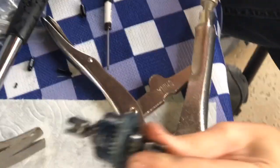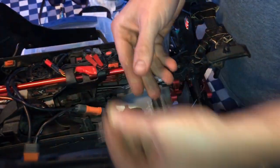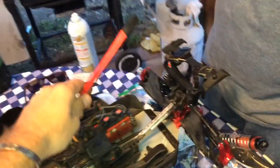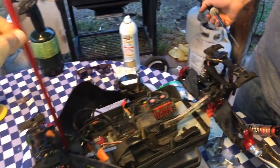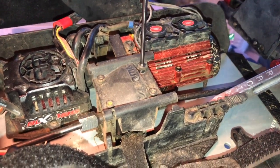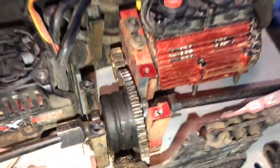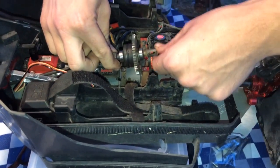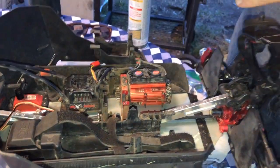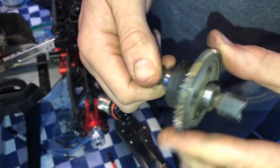Now I've got to take this apart and clean it. That part just pulls off with the little cotter pin — easy, two of them. Get that out of the way and then you've got to take this bar off. You just take that one out — one screw, bring it up. This thing looks really clean. Pull all the screws out and off it goes — and that's the center diff. It just kind of wiggle it up.